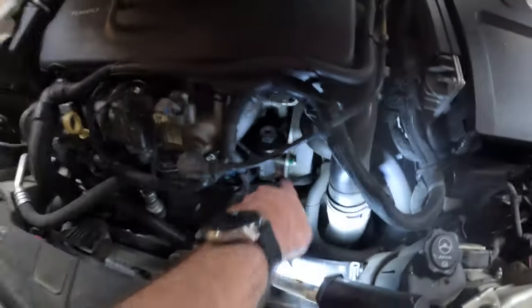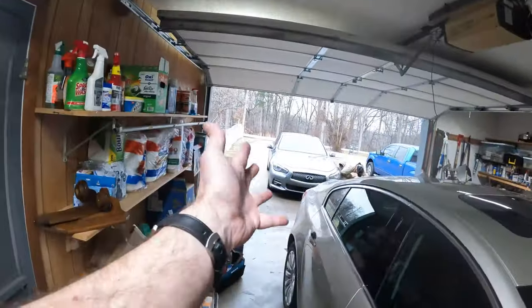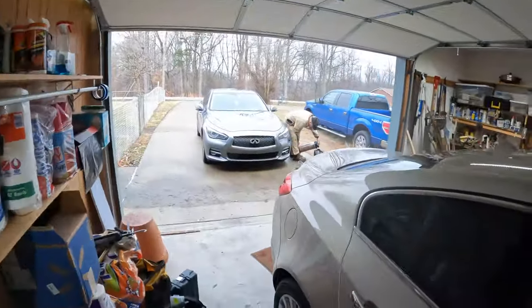A lot less mess. Now on a car like the Q, you're still going to have to get under to get to the oil filter, but it's still a lot less mess. I may do this on my car and then just change the oil filter. But on a car like this where the filter is on top — or any of your modern GM Ecotec engines, Cobalt, Cobalt Supersports, Equinox, anything like that where the filter is that way — this is the way to go. We didn't even have to jack the car up.